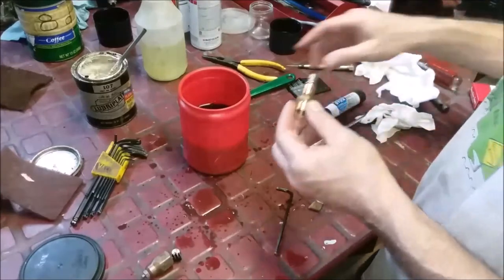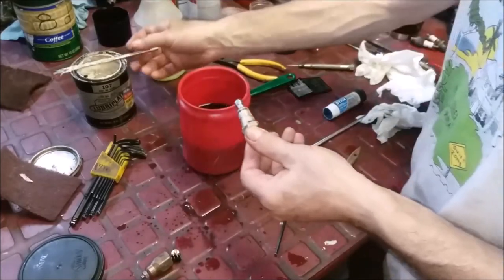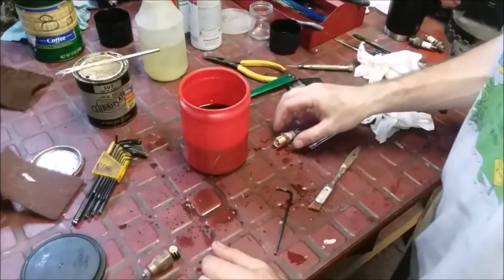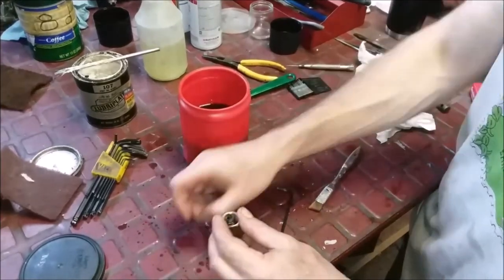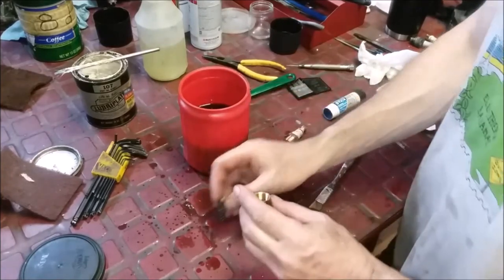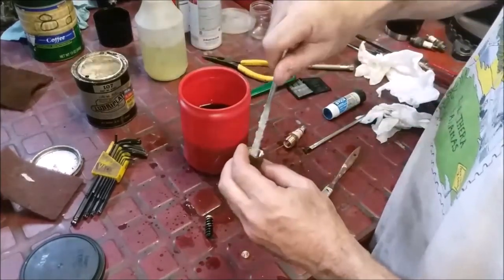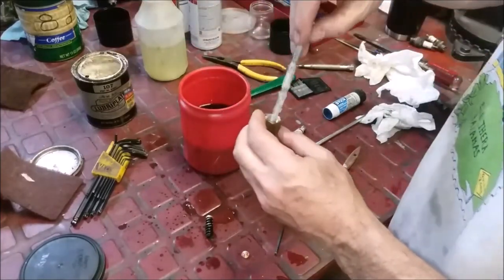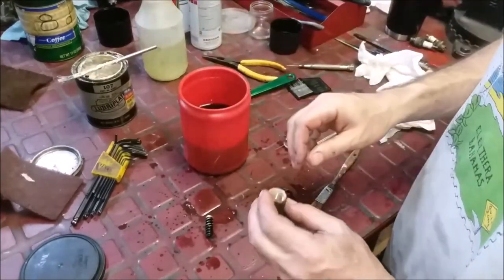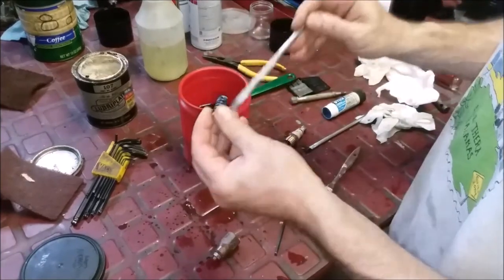We'll put a little white grease on it, just to make sure that it goes in nice and easy. We want to blow out before we put it together. Now there's the pressure side, and I think it'd be easier to install it. This just goes like this, right? This is adjustable, so we're not going to touch it. What we're going to do is grease it a little bit. Okay, it gets two of these cups. So one cup is here, they're the same. If you want, put a little bit of oil and grease in here. Just a touch. That's how I buttered it up. Now, make sure this goes in the right way. Add a little bit of grease to this guy so there's no issues.